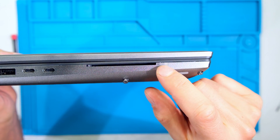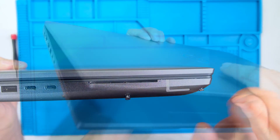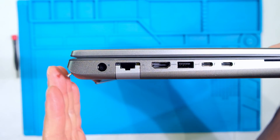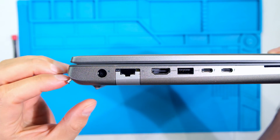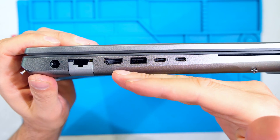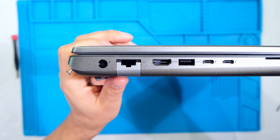When opening the front cover, start at the bottom left side — the side where the card reader is. Notice the angle here: the back cover actually cups around the inside. So when opening it, first remove the front part and then let it lift at an angle in order to clear this curve.